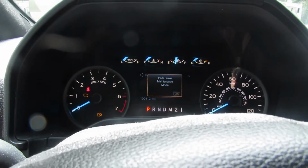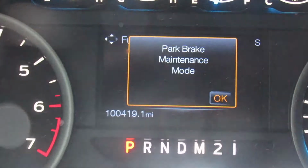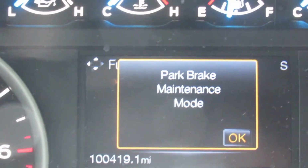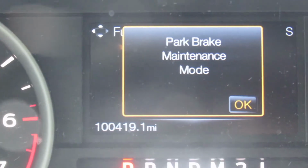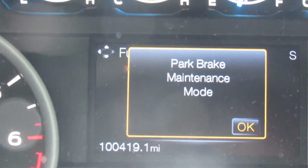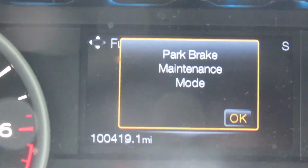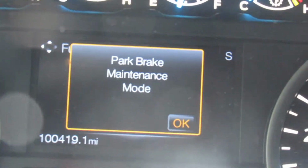Alright, I had to go back and watch YouTube. Sorry, a lot of things on YouTube you can find. So, you have a Ford F-150, push in your electric parking brake, push in your gas pedal, with your ignition on, don't start it, just your ignition on, then you turn the ignition off, turn it back on. You have to wait about 15 to 20 seconds. Do not release either one until you see park brake maintenance mode. It'll come up. So I did it, finally. But I had to go find it.